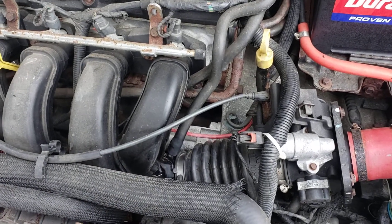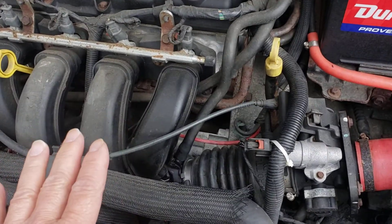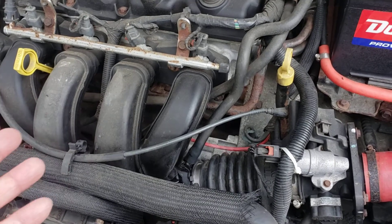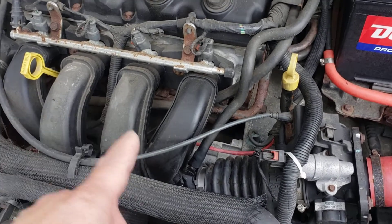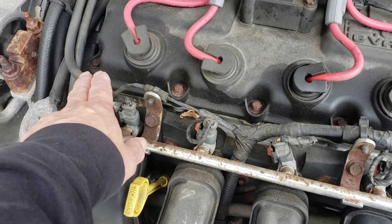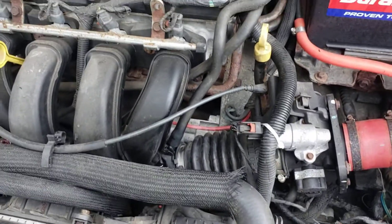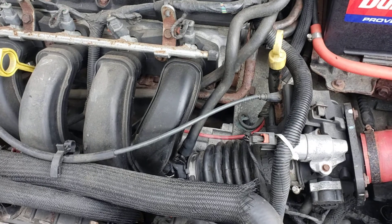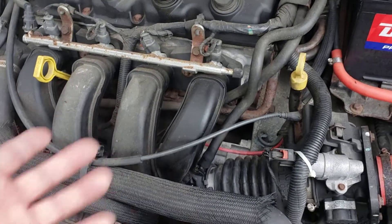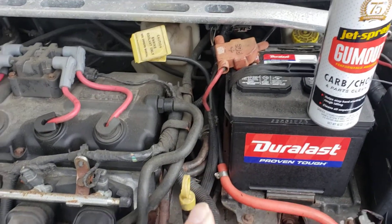The clue here was that it was 30 degrees in the area for at least a week or so. On this car, that means a frozen fuel line. You could put gas line antifreeze in your tank, but it stays in the tank — it's not going to help the fuel line. That plastic rubber line underneath the car could be frozen anywhere. Before you get crazy, you can either push the car into warm weather or use a portable propane heater to warm it up.